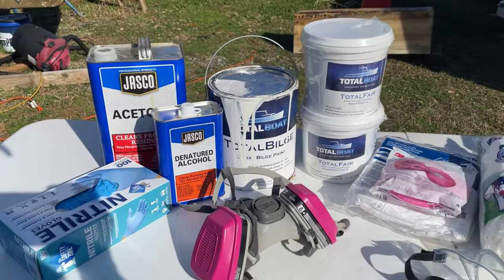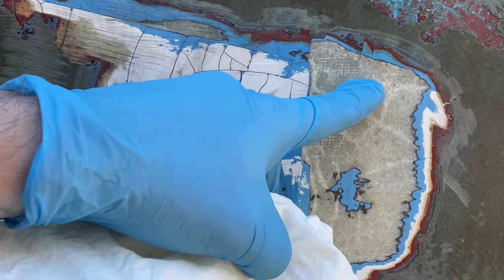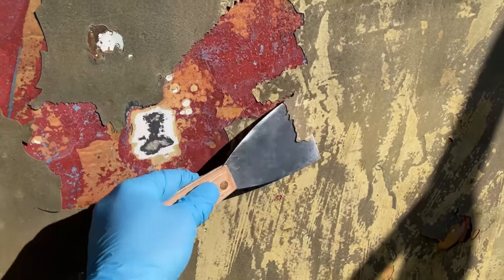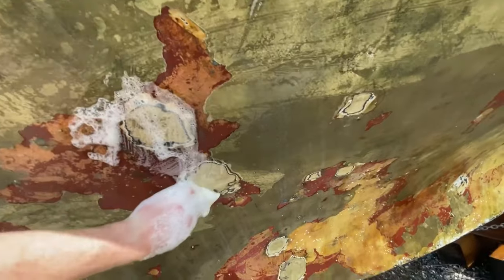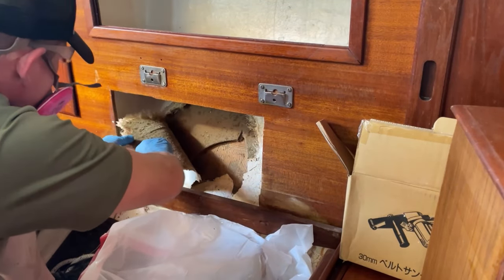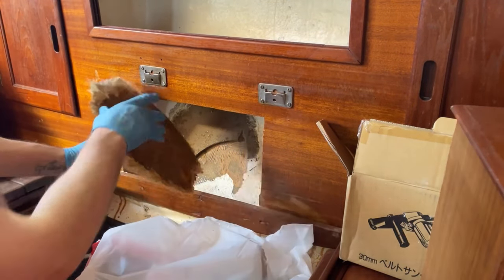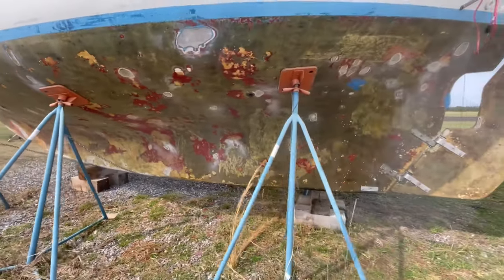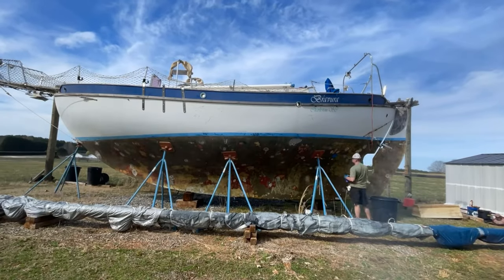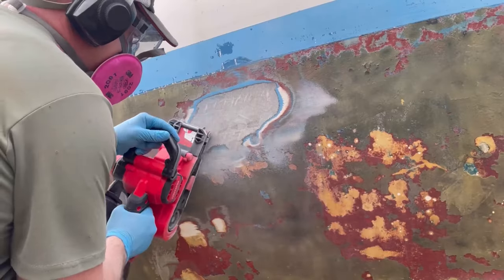On this episode of Restoring a 1974 Westsail 32, we grind away all evidence of hydrolysis in the hull. We scrape away the last of the ablative paint, prepare the surface for fairing, investigate delamination due to the hurricane, sand, fair, and fiberglass 97 different damaged spots of the hull, and much, much more as we prepare this Westsail 32 to be painted.